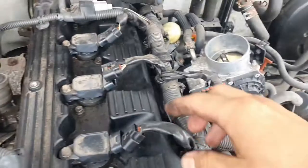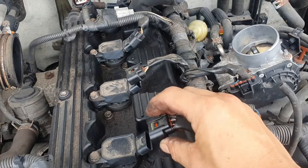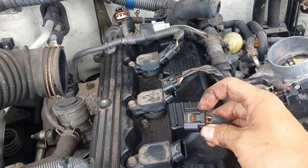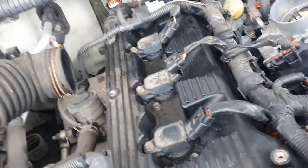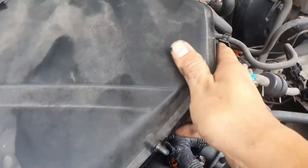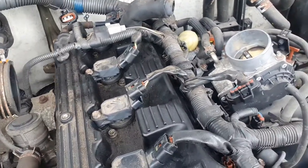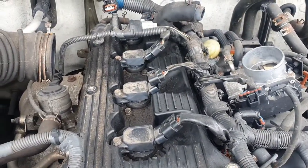The little box is off. I actually needed a pick to pry the clip off — it was being a little stubborn. For a lot of the ignition coil connectors, I try not to snap them since this is my daily driver. Also, don't forget to take off the vacuum hose for the fuel pressure that plugs into this portion here. Then go ahead and take off the ignition coils and get to the spark plugs.